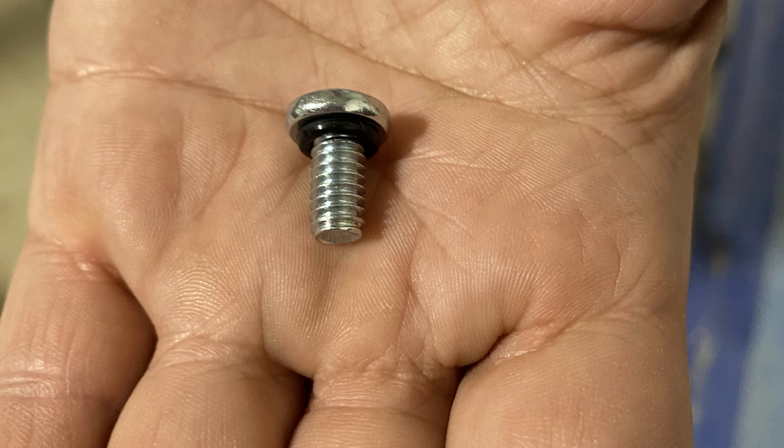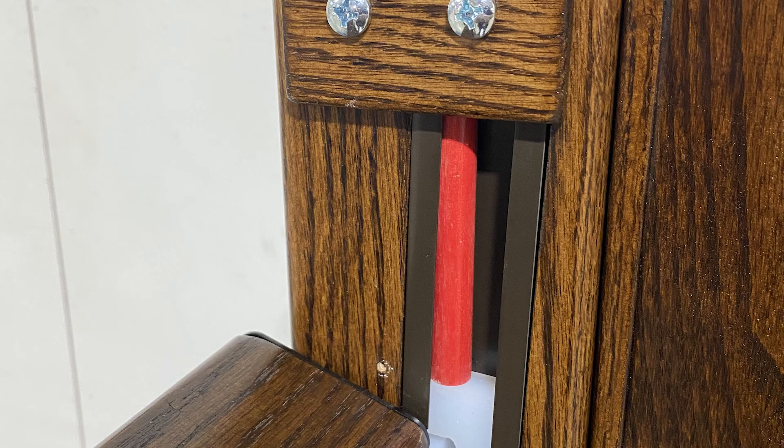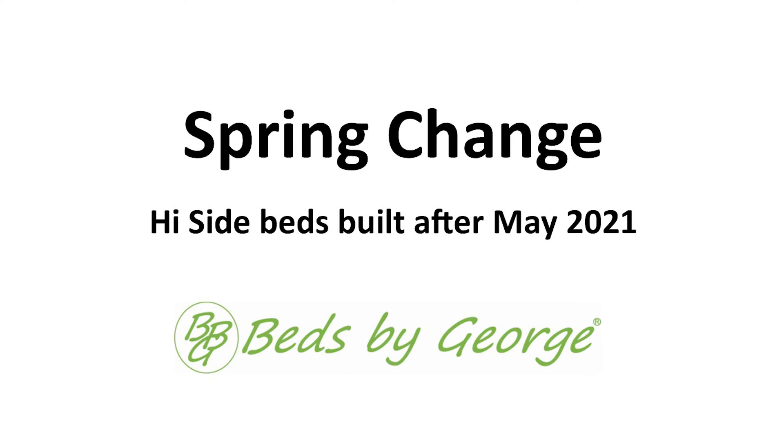This is an excellent time to check that the screws are in good condition, as well as the rubber grommet that goes around the screw — replacement ones have been sent if necessary. Then put the dowel rod back in place, pulling the spring down. Put the dowel rod in place and simply by pushing the door inward, it re-engages with the slide. Open the door completely and reinstall the plastic plate that covers the slot in the corner post.